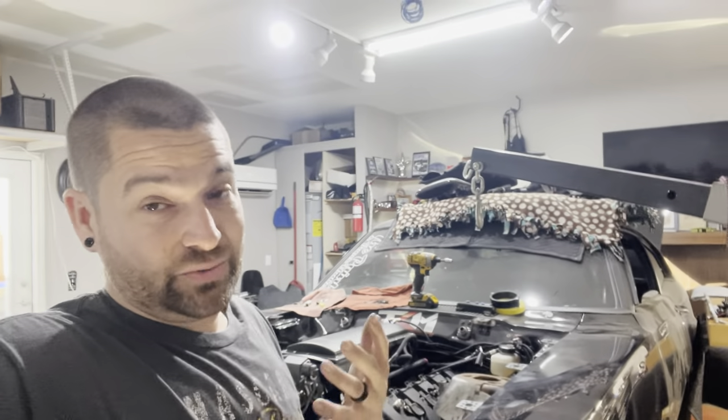We're not going to argue back and forth in the comments. We're going to use the seam-welded tube basically for the front end, do some sectioning, and build the front end more on budget. We're going to do the dash bar in the car but use DOM steel tubing for the dash bar - that stuff is about $200 for a 20-foot stick versus $38 for the seam-welded locally. I've got some DOM tubing left over from the rocker bars.